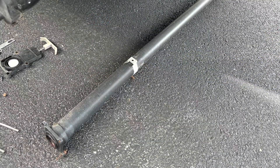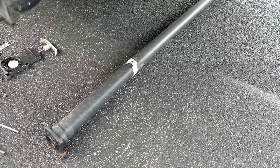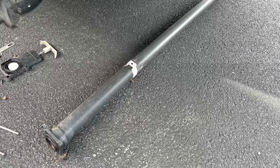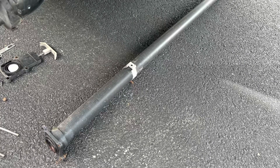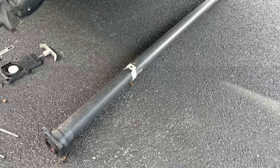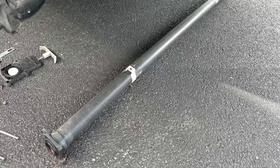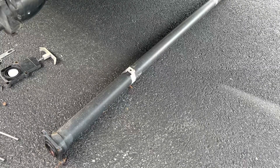To get started, unbolt both of the gate valves for the gray tank — there's one gate valve near the sewer outlet and one just beyond the gray tank. There are four bolts holding each one together and they're meant to come apart. Once unbolted, you can drop the whole line that goes from the gray tank over to the sewer outlet. Once that's completed, we're going to cut part of that apart to reuse.